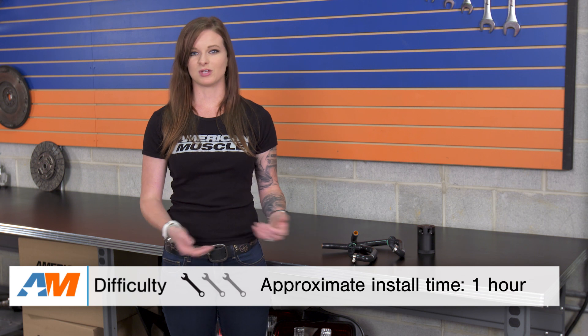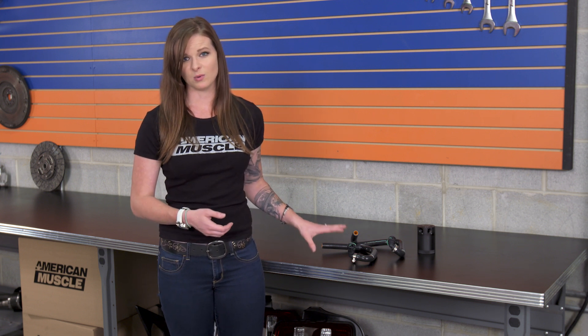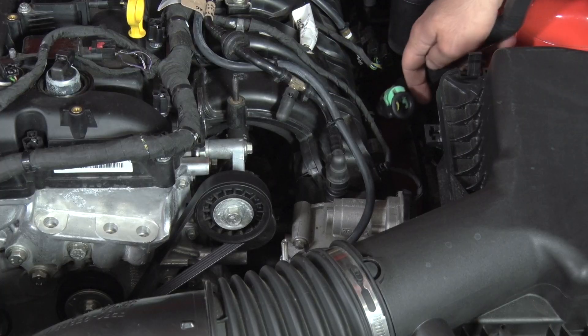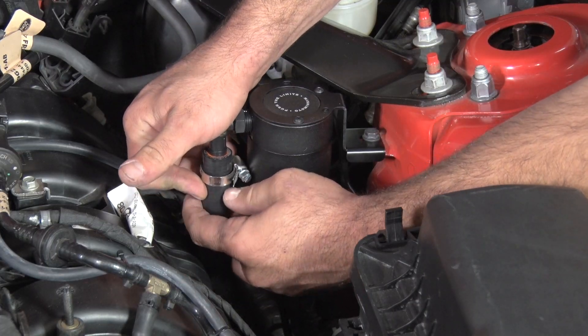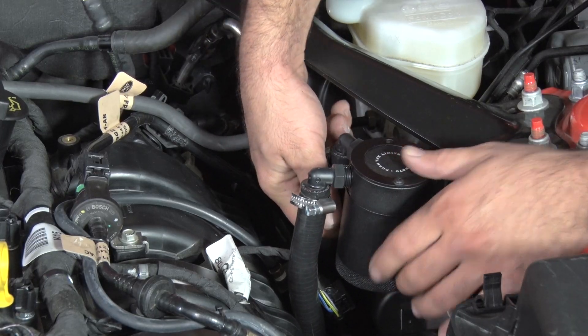The install is really pretty easy — you're looking at spending an hour tops, and this is a one out of three wrenches in the difficulty meter. You just need some basic hand tools. Start by assembling the can itself, getting your mounting brackets together and all the fittings into place. The engine cover will need to be popped off so you can get to your PCV area, which is right behind the throttle body. You'll swap your stock PCV hoses for the Mishimoto ones — all of the hoses just snap into place. The fittings install into the catch can, the can attaches to the bracket and installs on the car, then it's just a matter of connecting the hoses and getting your cover back on.